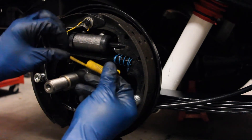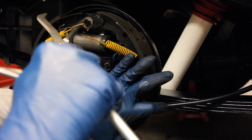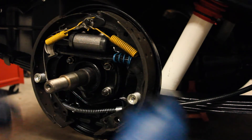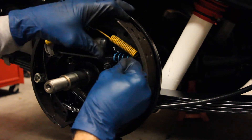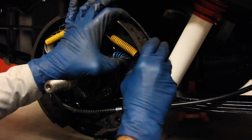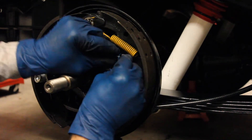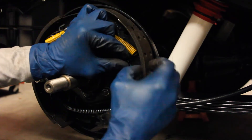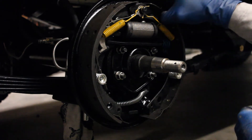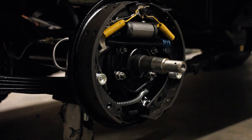Now take your other shoe spring and insert it into the second hole down. You'll probably want to hold the brake shoe in place because it has a tendency to pop out. Up and over, and now we've got that set. Make sure the brake shoe sits inside of that lever — I just did this wrong, so that's something to look out for. After a little finagling I got it set back in, pulling the top part of the brake shoe with a bit of force to slide it back into place. Now let's move on to the bottom part of the brake assembly.